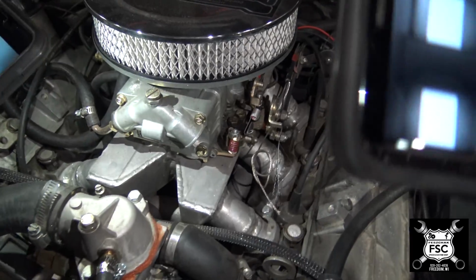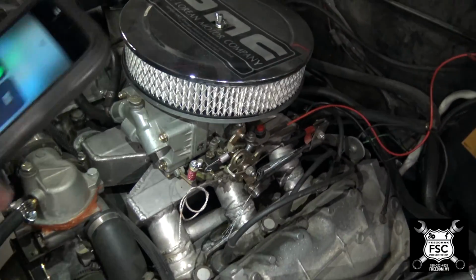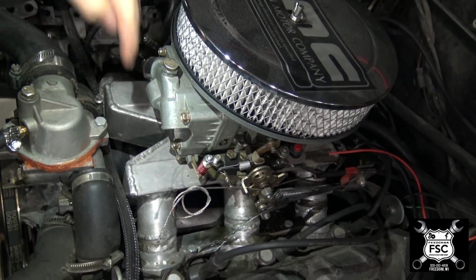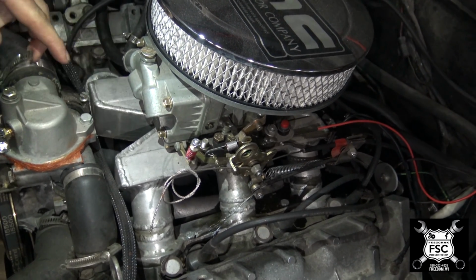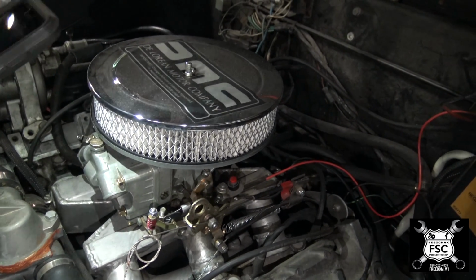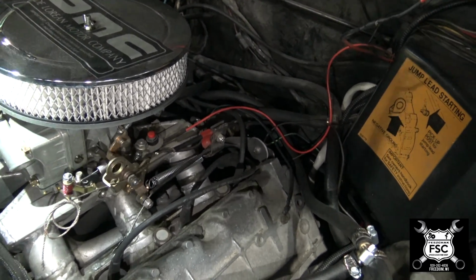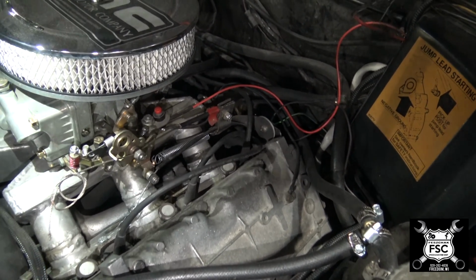Yeah. So there are a lot of advantages to this. This engine only uses 7 wires to run. You can get to the valley of the engine a lot better than before. You can get to all the clamp hoses, the cooling water pump clamp hoses that loosen up over time, especially when it gets cold. I can get to each tightening screw. I can see if there's any coolant leaking into the valley, which is the death valley, which will kill your engine if you don't take care of it, or if it rots away the hollow cavities, and you can just have a visual of what's going on down there.